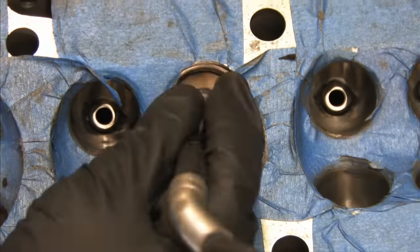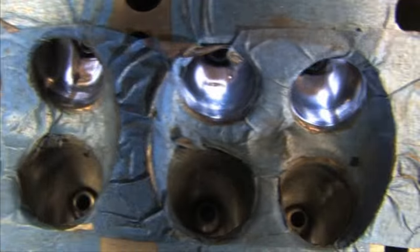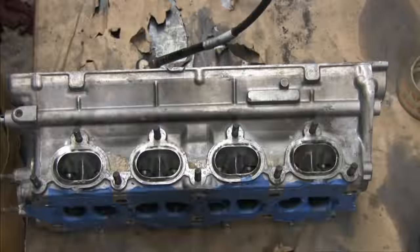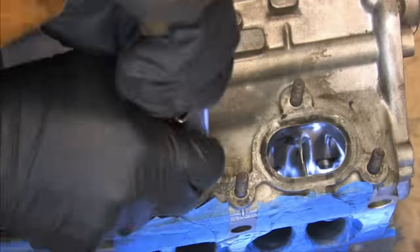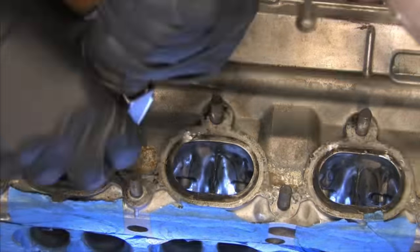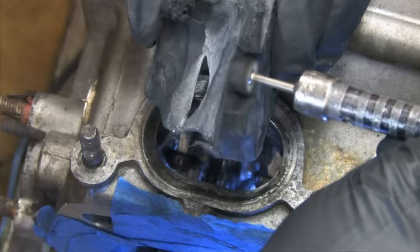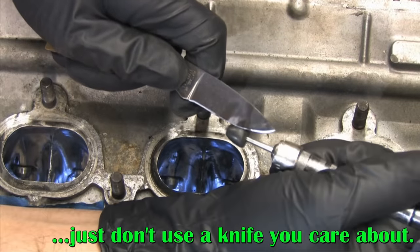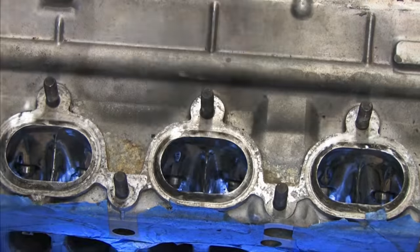I went through about a dozen polishing wheels and spent 3 hours on the polishing stage to ensure I got into all the little nooks and crannies and put as bright of a finish on this as I can. When you load up the polishing wheel and start applying pressure, rough cast traps the black rouge, giving it a hot, adhesive-like quality. The friction and abrasion will push the pile of rouge in front of the wheel and eventually expose bare metal. If you overload the wheel with rouge and it clumps, you can use a knife or another sharp, flat piece of metal to clean off the wheel. This scrapes a fresh surface into the felt and helps it pick up the rouge on the part a little bit faster.